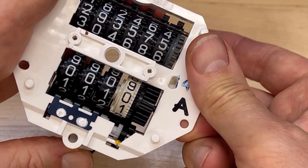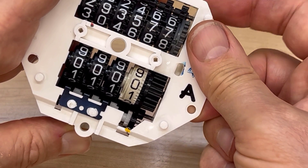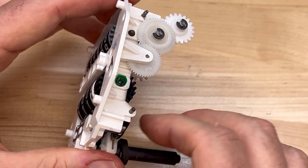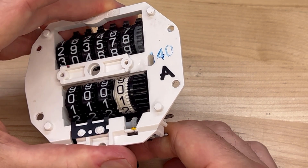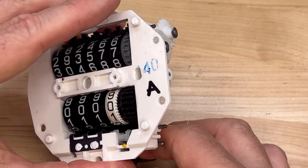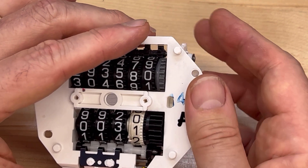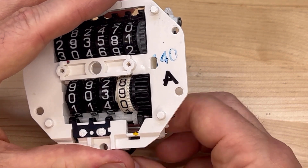And when you pull down on it, it not only sets it back to zero, but while it's setting it back to zero, there's no tension on the odometer gears. So the notion that resetting the trip meter is what causes this gear to break is pretty questionable, because there's no extra tension anywhere. You pull down, it decouples it — that actually frees up the gear, because now it just spins freely. And then when it goes back in place, it picks up that white gear and starts turning it, but that gear has to weigh maybe two grams. It's just an infinitesimally light load to add back to the gear set.